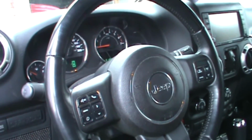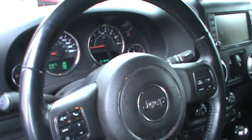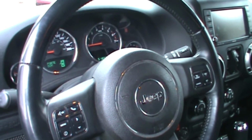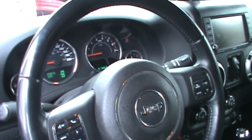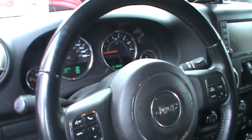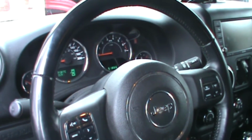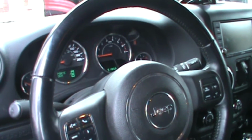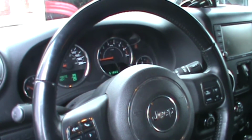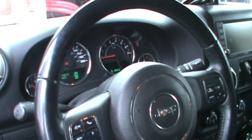Now, for those of you who have a ProCal chip, I can show you how to do this. If you want to make sure, for example, if you have your anti-slip system lights, the yellow lights on in the dashboard, I'll show you how to recalibrate your steering center with your ProCal. That's a feature that you can do with your ProCal, which is perfect. Once you perform what we've just been through with the track bar adjustment, then you take your ProCal and you do the adjustment. I'll show you how to do this.